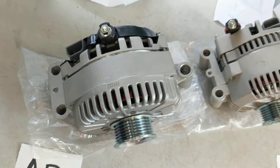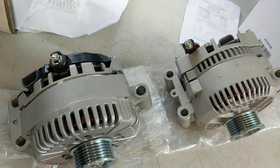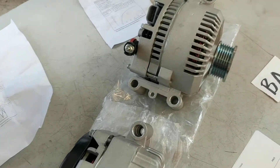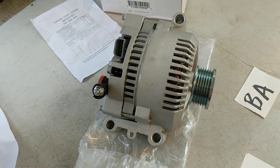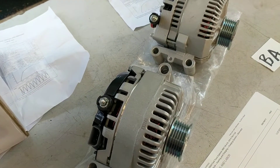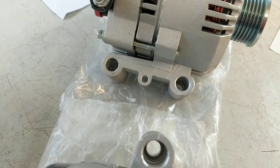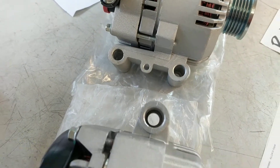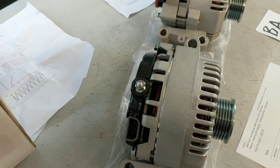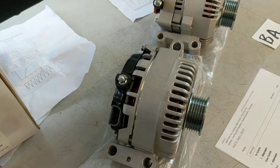I thought this would not be a big deal since there's enough cable length to make it work, but there's another problem and that's the overall size of the unit. This alternator is quite a bit larger than the other, and while it may still physically fit in the same given space, if we compare the mounting holes we see that they are way off from one another. So one of the bolt holes would not be used.